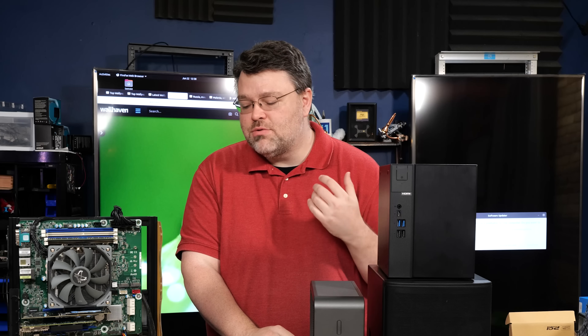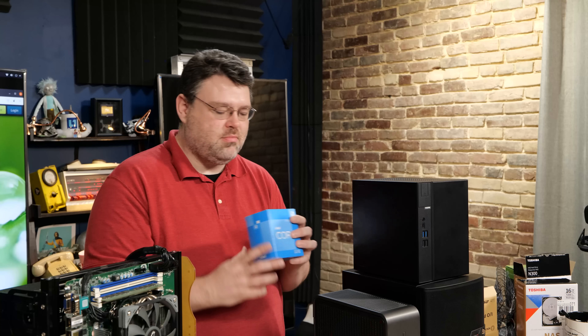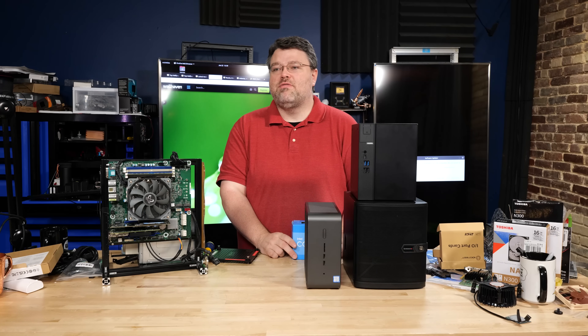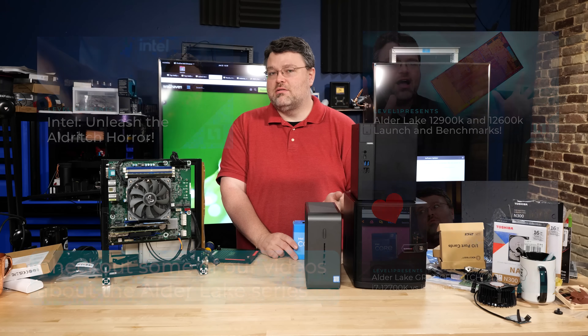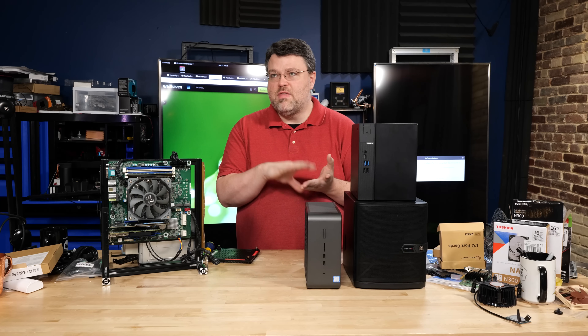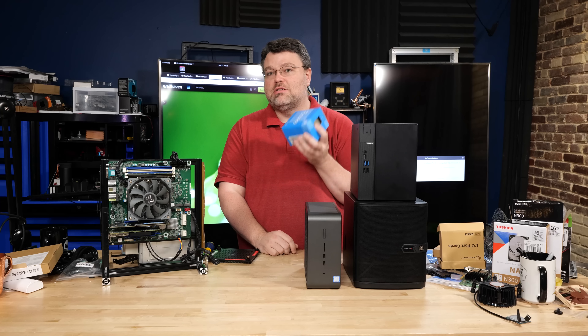There is a challenger on the horizon — I was going to make this video after I got more hardware, but it's been basically unobtainium. This is an Alder Lake i3-12100. This CPU is around $80 on sale — four Alder Lake P-cores. Alder Lake is very, very fast on a single core, much faster than AMD, especially on single-thread performance. When we're talking about networking, traffic filtering, Samba and that kind of stuff, single-thread performance is still king. Four P-cores with Hyper-Threading in a network appliance is really incredible.